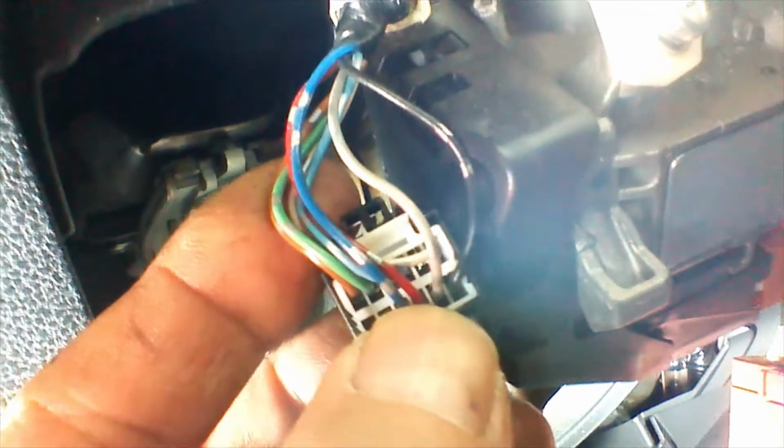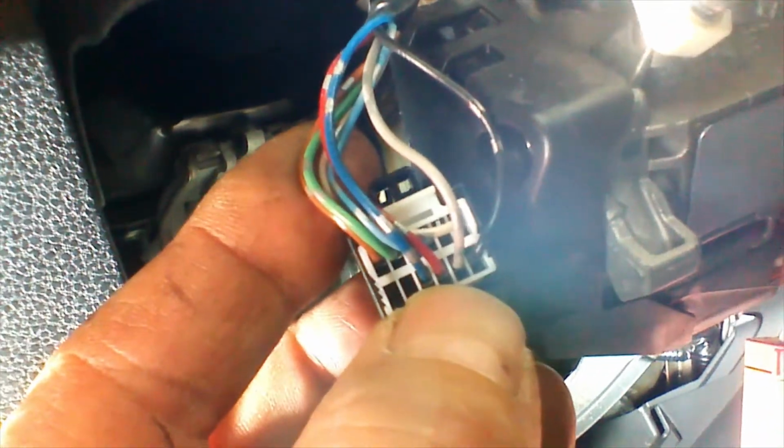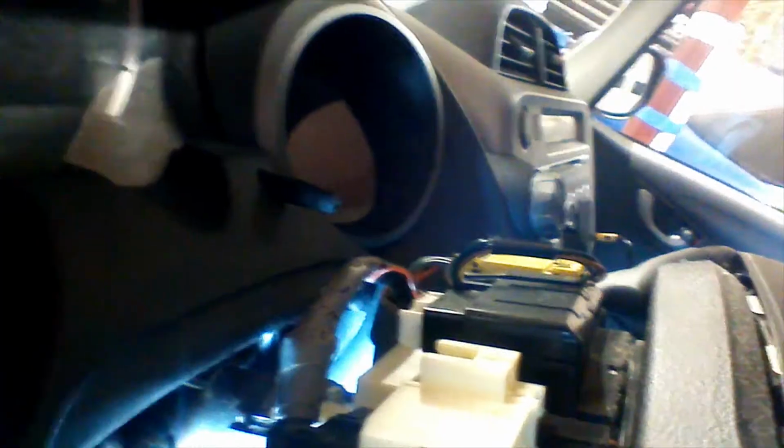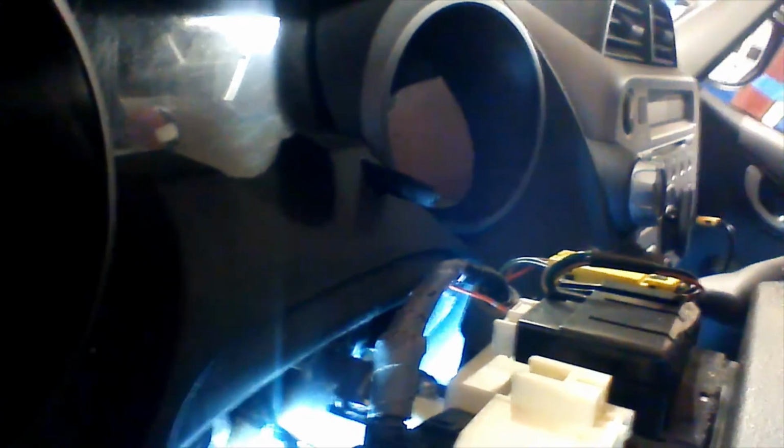You see we have the clip in the upright position. We're looking at it from the back. Match it up to your installation plan, and you will see that it's located at this gray wire right here. So if you're going to make the horn connection, there's a plug right here, top of the steering column. It's got a single brown wire. That is your horn wire.